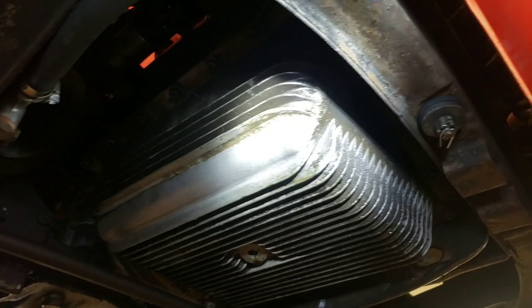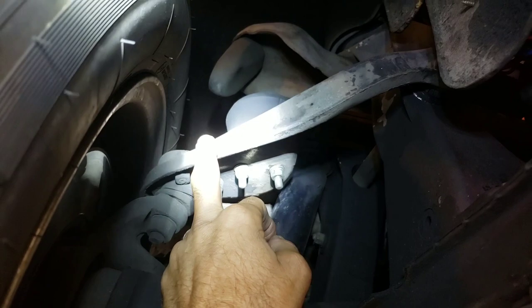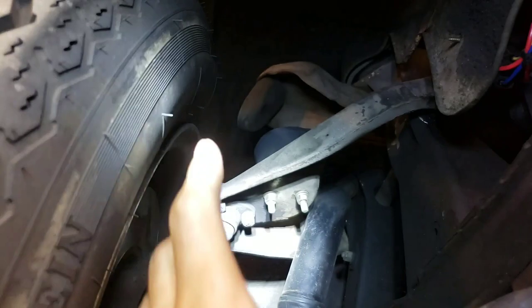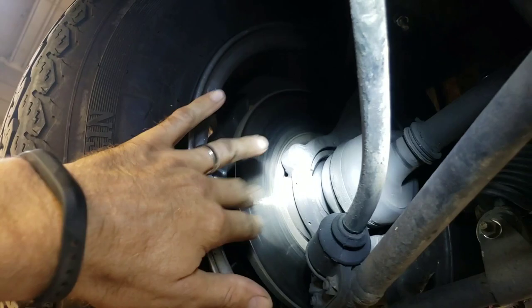Aluminum oil pan, aluminum block — look at that finned aluminum. Lightweight, that's pretty cool. It has a pretty big sway bar in the front as well. There's a big rubber bumper which is the connection point for the spring — it has a lateral transverse spring that goes across the car, and that is the connection point for the suspension. The disc brakes here are solid, not vented, and they have no backing splash plate on them. Really neat.